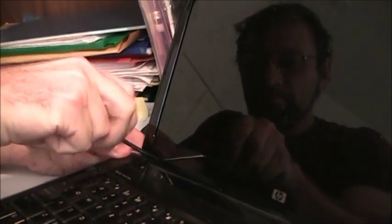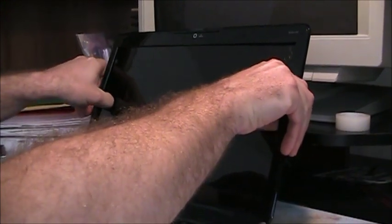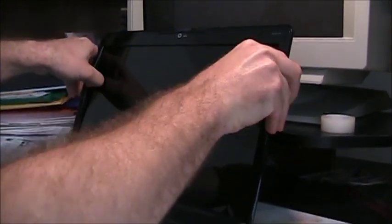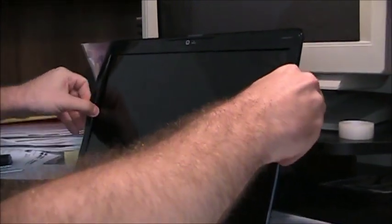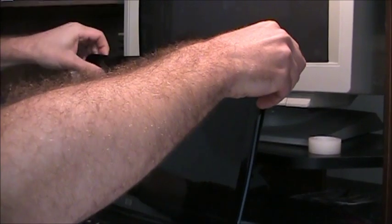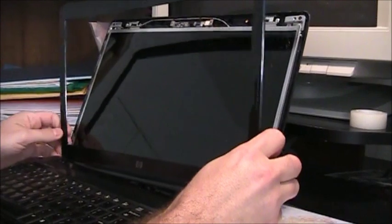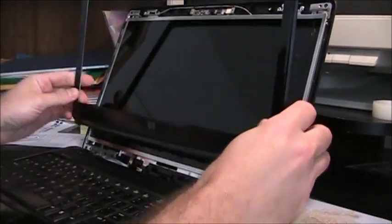The tapes are completely removed. Now we remove one screw and we remove the other screw. We are now ready to remove the plastic frame. You start from the sides and snap it off — you should hear the clicking sounds. The last click and the frame is off.